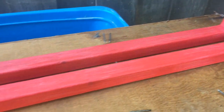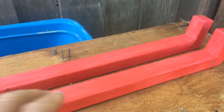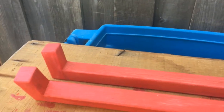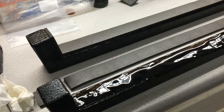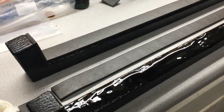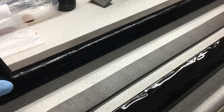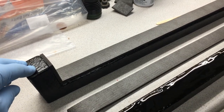The addition of paint on top will help also. Here they are now that one coat has dried - as you can see, they've turned red. It's almost like it puts on a slight plastic coating to protect it. I'm going to put one more coat on, let it dry, and then paint them black. I've got all these spacers here painted up black now. That RedGuard brushed on - I don't know if you can see the brush strokes, they're pretty rough - and I spray painted the black paint on. It'll give it a textured look underneath the trailer.